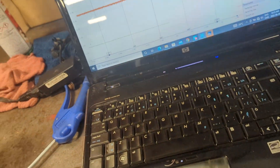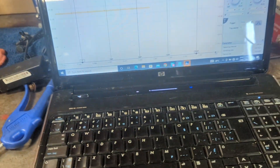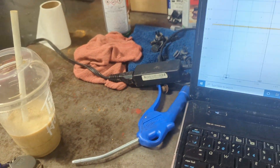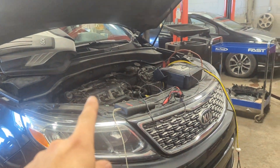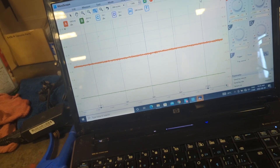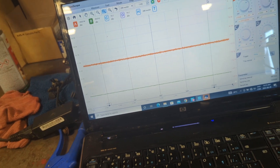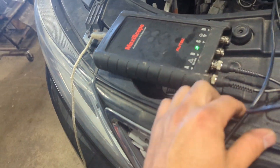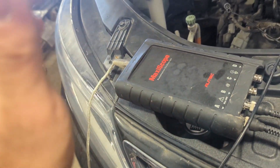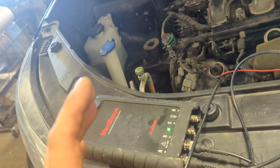Some of the basic tools that you are going to need to start off this test — I believe we are gonna end up finding low compression on this engine on specific cylinders. So the first test I want to perform is just a relative compression test. In order to do this I would suggest getting yourself a laptop, or if you have a tablet with a scope, use the tablet. I'm gonna be using my laptop along with the Maxi Scope. If you don't have the Maxi Scope, use whatever scope you do have. The Hantec 1008C is able to do all this — you just have to be careful with your settings or you're not gonna get the proper definition needed to verify the waveform correctly.